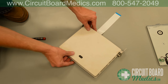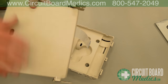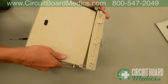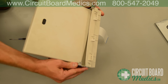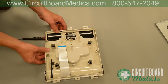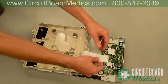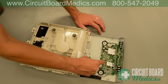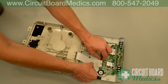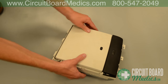Reattach the DVD screen casing. Slide the DVD screen back into its case while it's in its open position, then close the screen. Attach the new ribbon cable to the other half's plug — make sure the silver contacts are facing up — and press the two clips down. To reassemble, repeat all the previous steps in reverse.